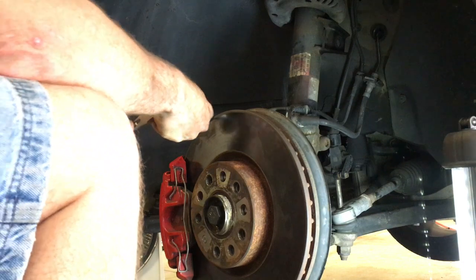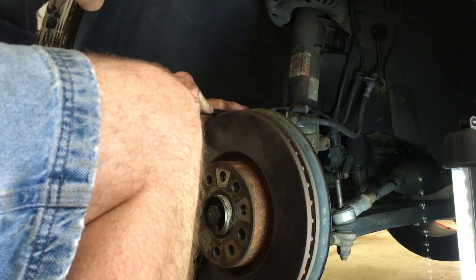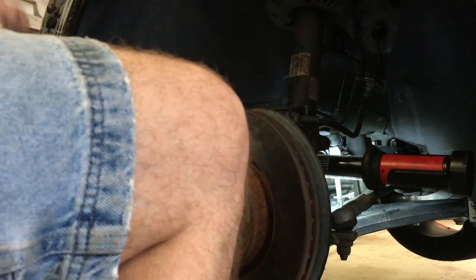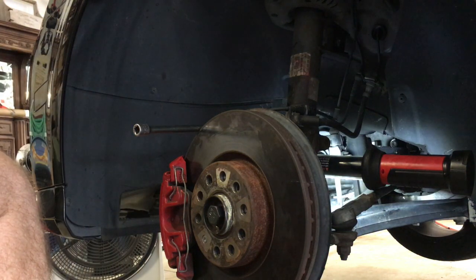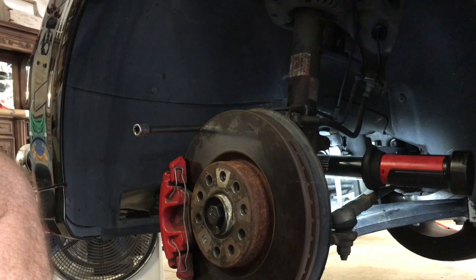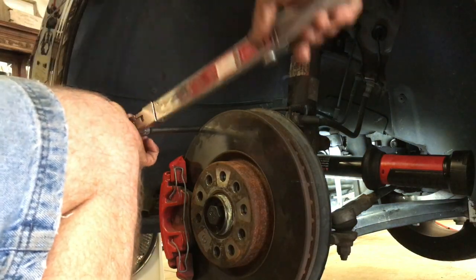So what I'll do next is need you to be on the brakes. First one, what was our torque? 70. It's 200 Newton meters for the metal. Oh, I still have it set. So it's 50. It's like 200 for the... it's like 52 essentially. 52, 70 Newton meters, right? It's like 52. Round ones, small ones. Foot pounds, yeah. And then, so I'll torque them all first. Okay, you holding them?